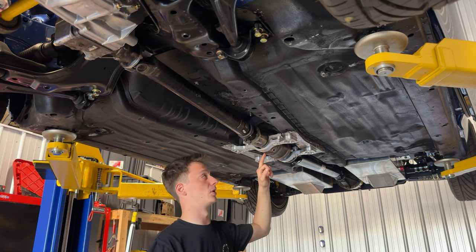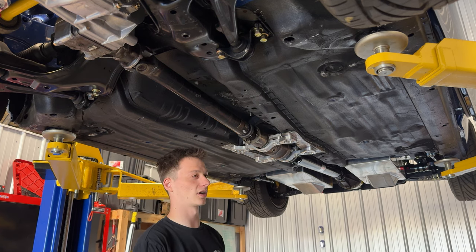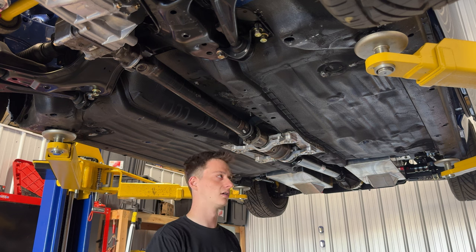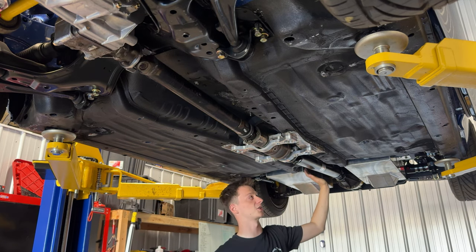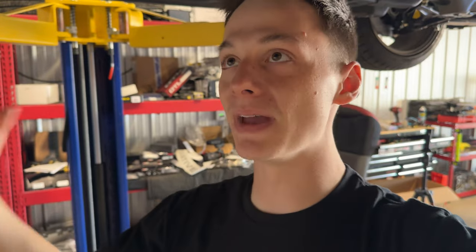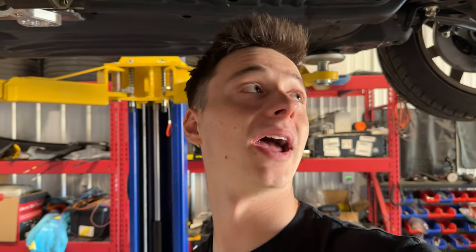Our viscous we have to go through, rebuild, and recoat — it's a little corroded. We're going to put a different weight fluid in it; I think we're going to try a 40 or 60 weight fluid. The rear section is from the S1, so that rear section is good to go, and obviously we have the wagon diff. They always say build a car and then paint it. I did the exact opposite — the first thing I did was do the undercoating and repaint the car, and that left us with a ton of areas to touch up.